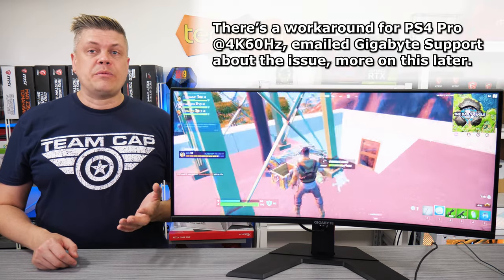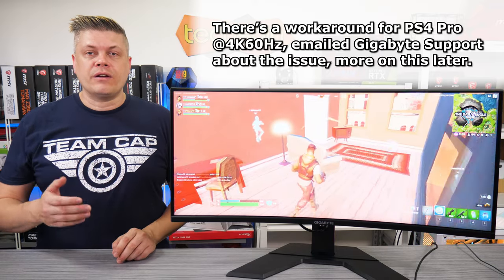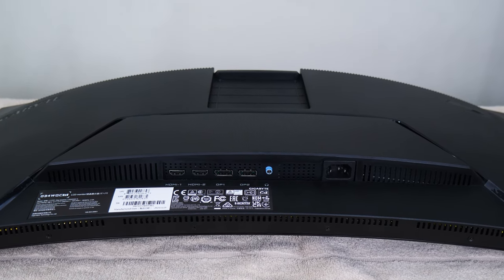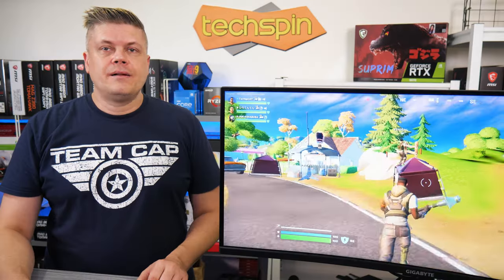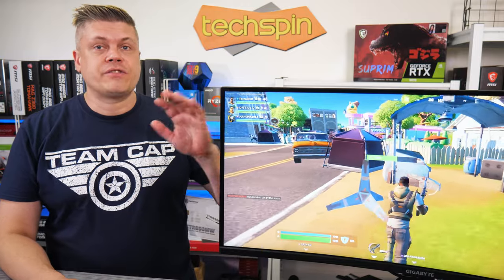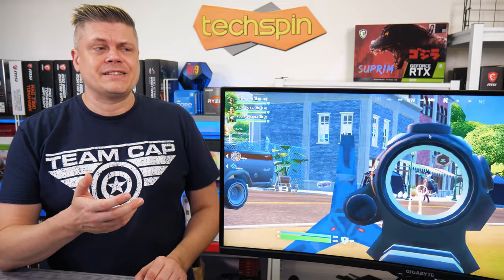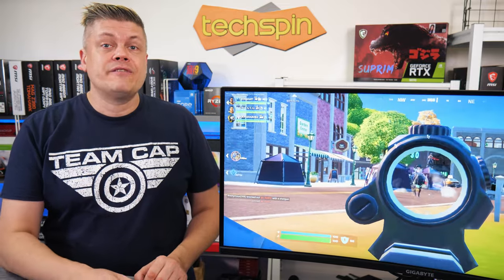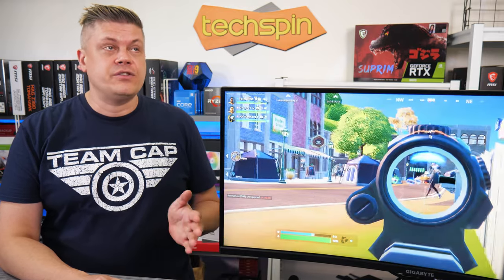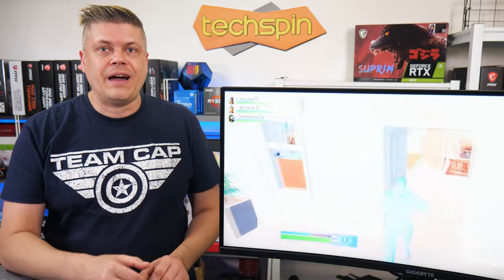We tested the HDR10 capability with PS4 Pro 4K Netflix, and you'd get the same white pop and vibrant colors you'd expect at the 480 cd/m² level. With FreeSync support and G-Sync over DisplayPort only, it's PIP and PBP capable. For gamers, the overdrive balance setting seems to do best with a bit of overshoot. Gaming on the screen is really great — the ultrawide area really immerses you in the action — however the real challenge will be tweaking your game settings to hit 144FPS. Even Fortnite with an RTX 3070 required medium settings, often hitting 95 to 120FPS with some stutters. You'll probably need a 3080 or better to hit higher settings.